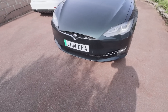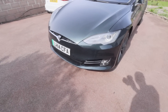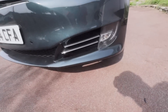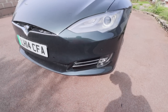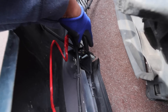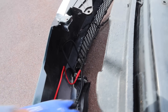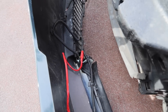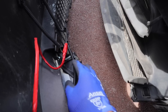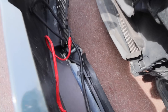Day two. We're taking the bumper off again because the louvres still aren't working properly. This time we're going to look at the position of the motor to see if that's causing the louvres not to open. Bumper is off, and what I want to do is take off this motor and see if it has a standard position it goes to when it expects the vanes to be closed. We'll activate the vanes by putting the key in the car and hopefully that will find its closed position — it should open, then close, and that's the position we'll use to refit it.